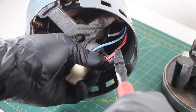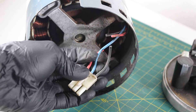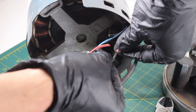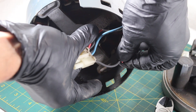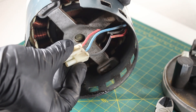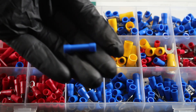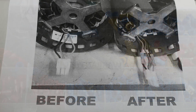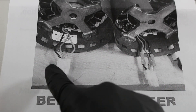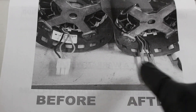Do the same in the same position. Basically what we're going to do now is switch this — these will go together, and then these will go together. The black connects to the red, and the red gets connected to the black. We're just going to basically switch it around. So we just cut our wires, we're going to strip back the insulation, and we're going to use a butt connector. Here are the instructions that actually came with this motor — they had you cut the wires and reverse the red and the black using butt connectors. I'm going to show you exactly how I do that.